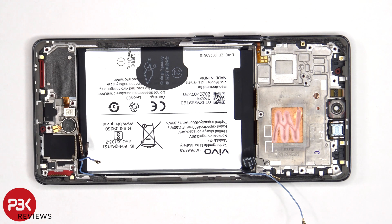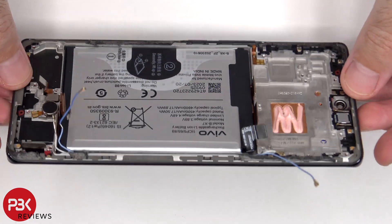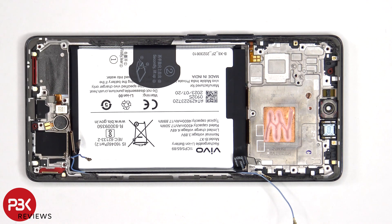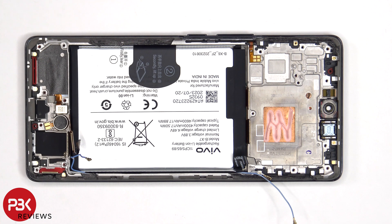To replace the screen, you have to pry off the back plate or back glass, remove the screws on the bottom speaker assembly and the speaker assembly itself, disconnect the flex cables and remove the sub board, giving you access to the screen cable. Remove the red rubber gasket, heat up the front of the phone to loosen the adhesive, pry the old screen off, apply new adhesive, reapply the new screen making sure you run the flex cable back to the opening in the mid frame, and reassemble the phone.